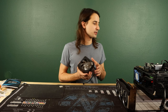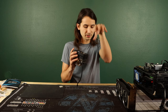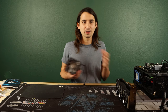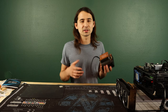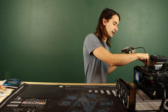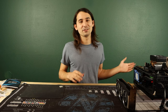We're going to use a Wraith Prism cooler for this video — it's a blowdown style cooler that pushes fresh air straight down onto the motherboard and over those VRMs, which are completely exposed and need airflow. Before, I always did these videos with no airflow over the VRMs and temperatures would soar. This is the kind of cooler you should use with a motherboard like this with exposed VRMs. I'm also adding a second fan to blow air over the motherboard, which is completely different from those previous worst-case videos.